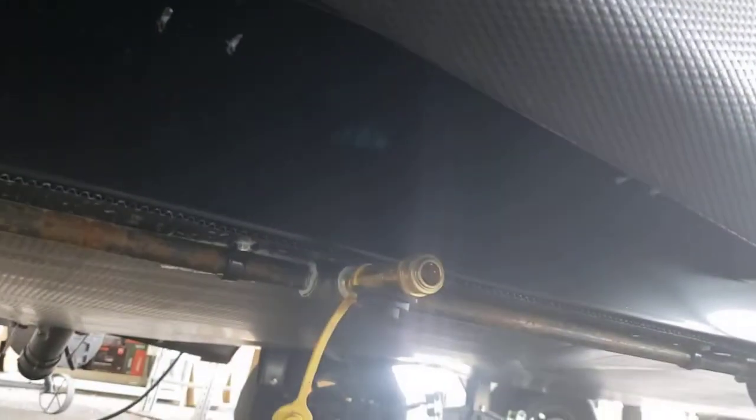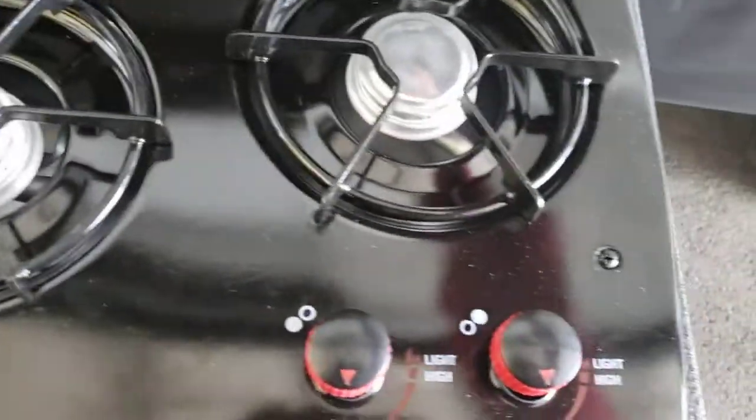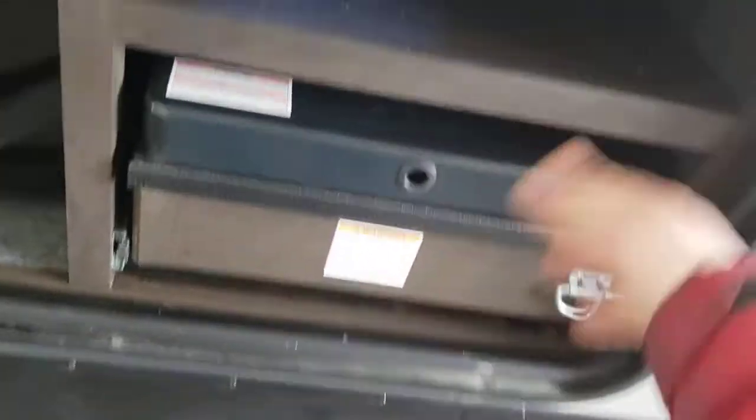A little outdoor kitchen area — there's that hose we went over before. Slide-out cooktop. The propane hose goes to a quick disconnect right there — plug it in there, open up that valve, and it'll bring propane up to the burners. They have little stands that fold out. You just turn it to whatever you want to light and light it with a match or a barbecue lighter. Make sure when you're closing it your hose isn't in the way. You do have a little lock there that can get stuck sometimes — fold it up and swipe it out of the way, then this gets latched closed to keep it from swinging and bouncing out and hitting the door.